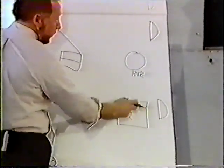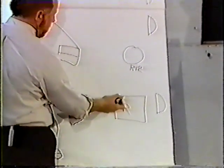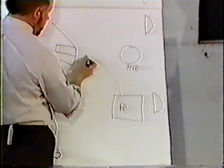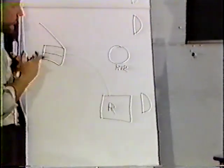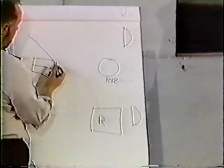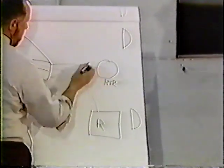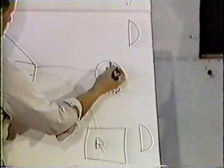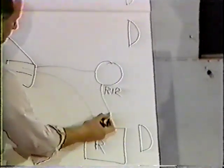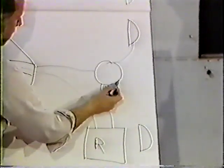Supply air fills the rear axle tank, and that air in the rear axle tank through our supply line enters the primary circuit of our foot valve. When the foot valve is actuated by the driver, delivery pressure or signal pressure enters our relay valve, forces a piston down, and sends that pressure onto the service chambers, applying the rear axle brakes.